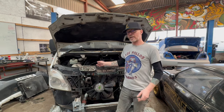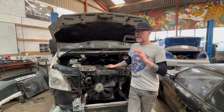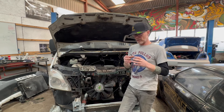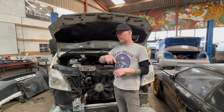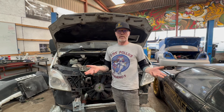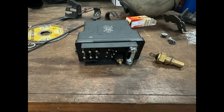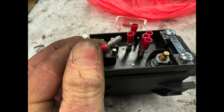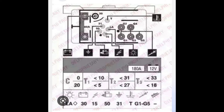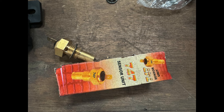Glow plugs — the 606 needs a lot of heat to start. I tried to use the original glow plug harness and glow plug relay for the ECU, but it just wouldn't put them on long enough. The CDI engine does not need to heat these as long. So I got rid of that and put in the control unit out of an earlier model, and put a separate glow plug light on the dash — old school — along with an oil light, just like an old-school vehicle. This is the glow plug module out of an early 606 TD. I had to make up the terminals to fit. I'll put a link in the description with the wiring diagram. For this glow plug module, a separate temperature sensor is required. Luckily, there is a port in the head just to screw into it.